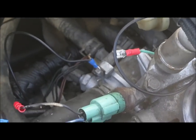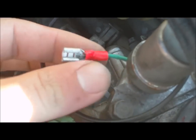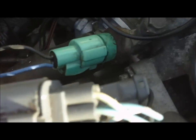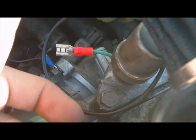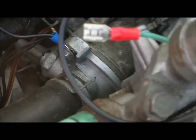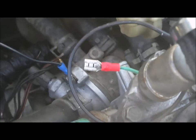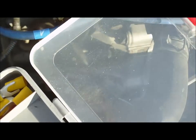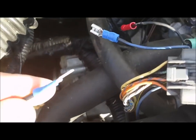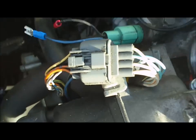I'm going to show you the easiest, most simple, proper way of doing that. If somebody has hacked off your harness, put a female connector on the green wire and a female connector on the blue with black wire. This is your VTEC solenoid power source. This is your VTEC solenoid pressure switch, and this is just a ground wire. Ground the black wire — I grounded mine to the thermostat where other stuff is grounded so I knew it would be a good ground. Run a length of wire — I labeled mine blue for pressure and red for power for the VTEC solenoid. I used 18-gauge wire; it's a little thicker than stock but it'll be alright.